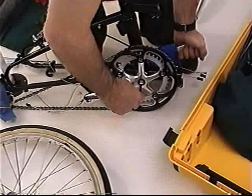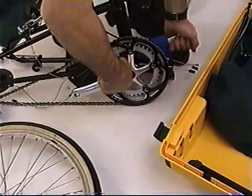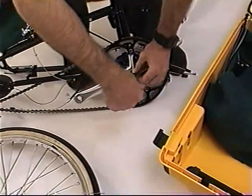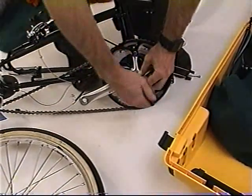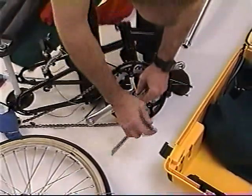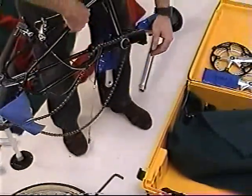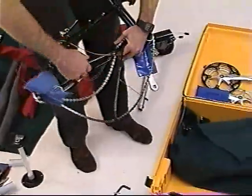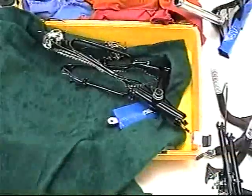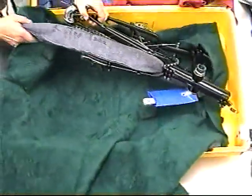To pack the whole bike into a single suitcase, you'll need to remove the right cranks on both the front and the rear portions of the bicycle. To use the one key release, use the allen wrench in your tool kit to turn the crank bolt counterclockwise. At first it'll seem a little bit loose, and then it'll tighten up again. As it tightens up, continue to turn it counterclockwise until the crank is fully extracted off the bottom bracket. Put the rear end of the bike in just like as a single, as in a double suitcase.